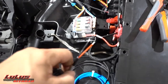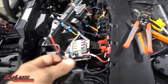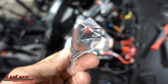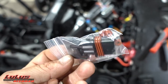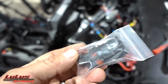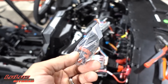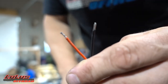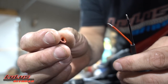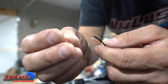You could run regular ends on these wires and connect them directly to power and ground, but I like using the bus bar terminals — it makes a really nice clean look and it's not that hard to do. I ordered a bunch of these on eBay, pretty inexpensive. I'll go through the process so you guys know how to do it if you want to go that route. Cut the ends of your wire about this long. Dump your packet out — you'll have a couple of weatherproof pieces. Install the flat side onto your wiring — one on positive, one on ground.